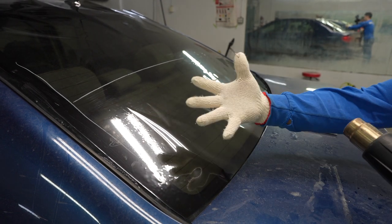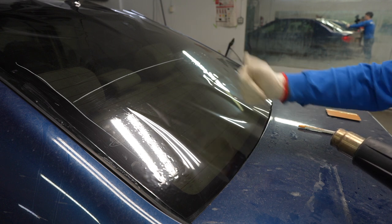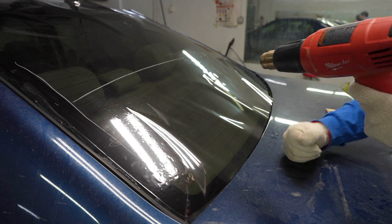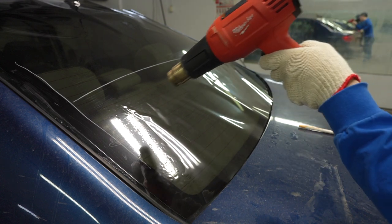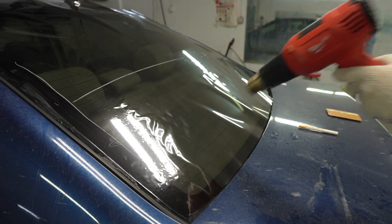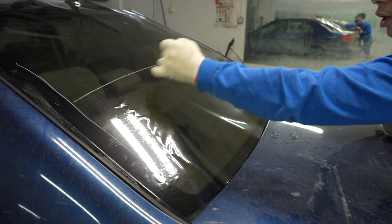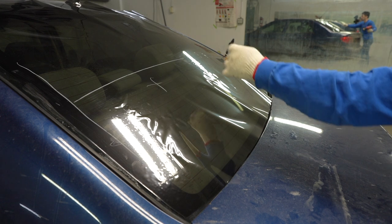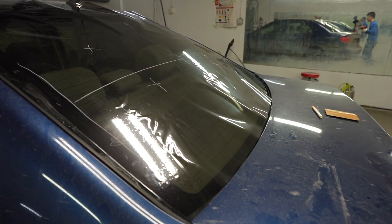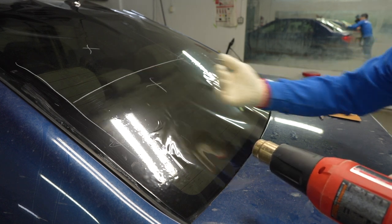With a wool glove, it actually helps your hand glide — we're using the glove method. We're going to let it come up to temperature on high heat. The key is to keep consistent heat moving. You see that there — that zigzag is exactly what we're looking for. Then we're going to split it into four quadrants — do this quadrant first, then this one, and vice versa on the other side. Once you get it here, you can actually swoop — that's what you're looking for.